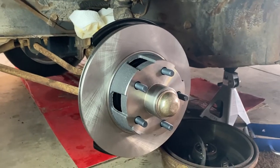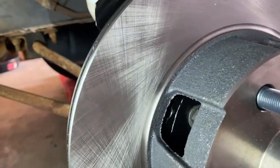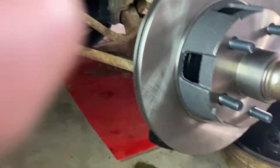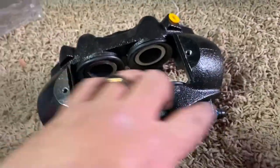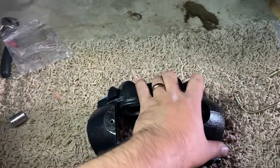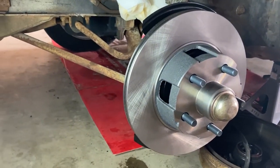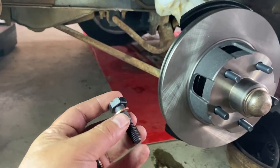Here's my caliper — the holes are there: one and two down there, on the back. When you put this on, the bleeder needs to go facing up. The bolts on the back are going to go on the back of the caliper. I also have this tube that's going to fill both of them to make sure the pressure is even on both sides for both pistons. I need some red threadlocker on here and we'll get these bolts installed.